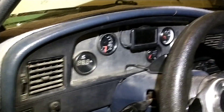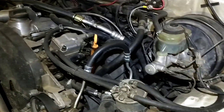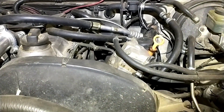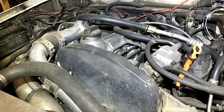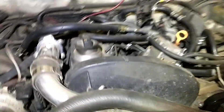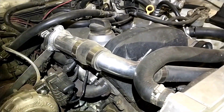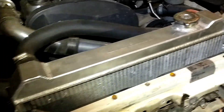For gauges, I didn't really like the Toyota gauges, so a custom setup was the best option for me. I've got videos on making Jeep gauges work, and I could have made these Toyota gauges work too — mostly it's about keeping the right sensors. The big ones to keep are oil pressure and coolant temperature if you want those working. For the tach, you need the wiring to the coil. If you go with an automatic, you'll also have to deal with the throttle position sensor and any downshifting cable or electronic connection off the throttle pedal.